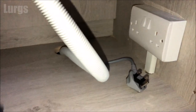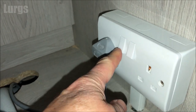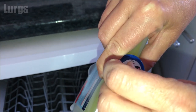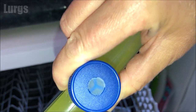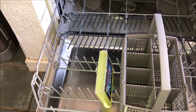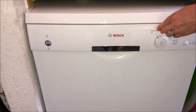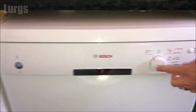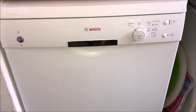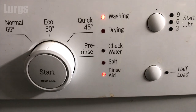Once you've cleared out all the debris and dirt, it's a good idea to run a dishwashing cleaning program. Plug the dishwasher back in and switch it on. Take some dishwasher cleaner — remove the sticker on the top, don't try to undo the lid. Place it face down in the bottom tray; the film on the lid dissolves with the heat, so don't try to unscrew that lid. Then just run the hottest dishwashing program you've got. A few hours later you should have a sparkling fresh and clean dishwasher.